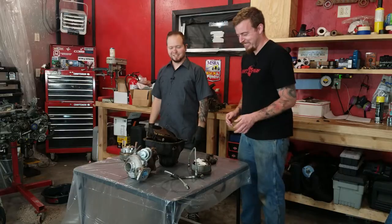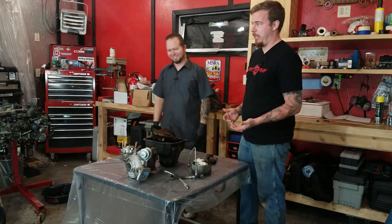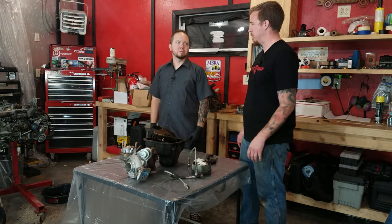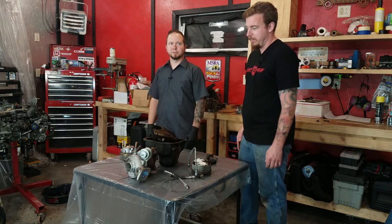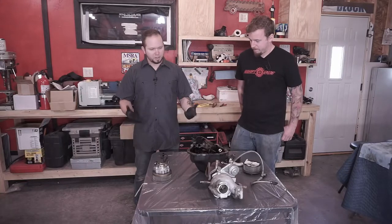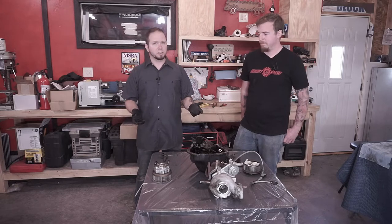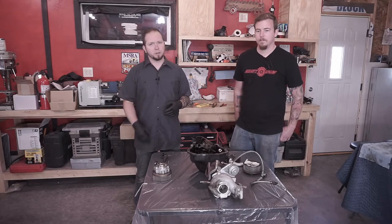the bearing failed, broke, same difference, you've got metal shavings in all of your oil passages, so we need to clean all of that out. Otherwise, it's going to cause more problems once we reassemble everything. Precisely. They end up in all kinds of random spots because pretty much anything that the oil touches, there's a chance the shavings are going to make their way in there.